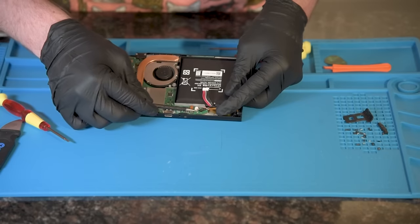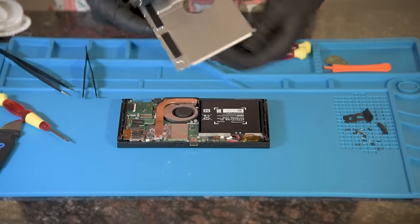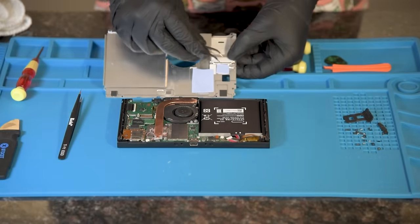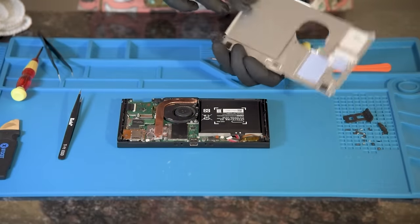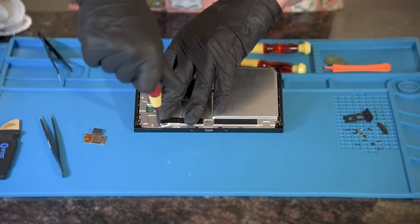Now finish connecting any cables that you haven't installed yet. Always connect the battery last after checking all the other connections. Next up, we'll be installing the RF shield. If you're not planning on using the shield, then go ahead and input the SD card reader. If you are using the shield, then wait until after to install the SD card reader.